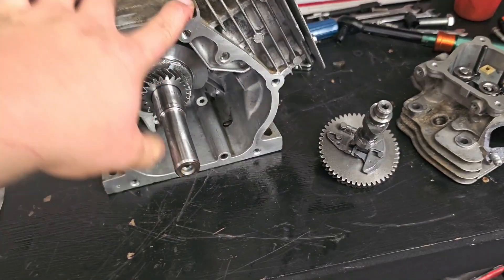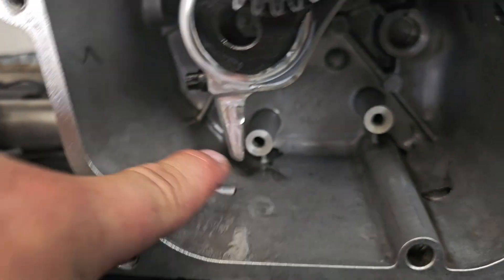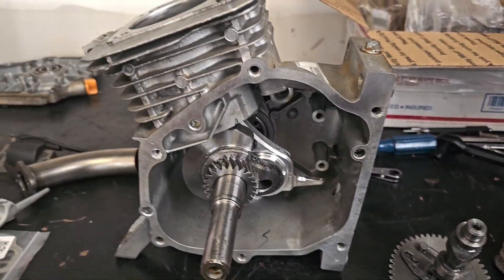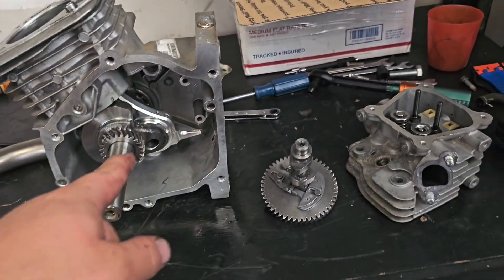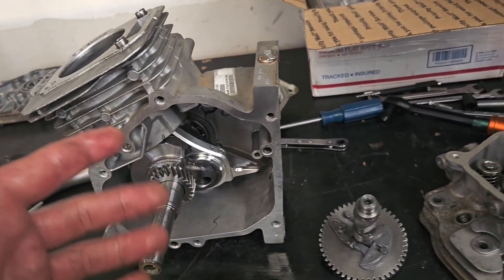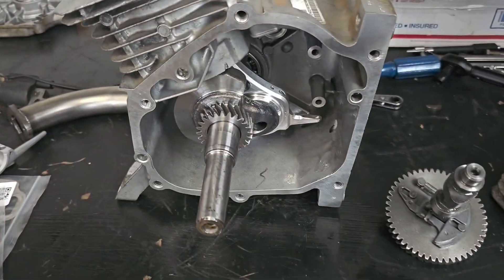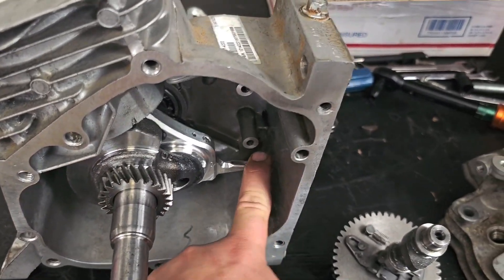So sure it's working against gravity, but it doesn't make too much of a difference because the push rods are doing a lot of the work to siphon the oil up to the valve. Now there is this oil cavity that fills up just a little bit past the end of the splasher. When you rotate the engine vertically, you're actually expanding that oil capacity. So instead of 16 ounces or whatever the manufacturer recommends, you'll need to add around 30% more oil — so instead of 16 ounces, you'll need 24 ounces of oil. That basically just brings the oil level up enough for the splasher to do its thing.